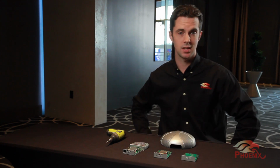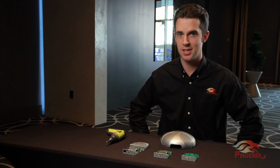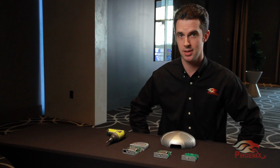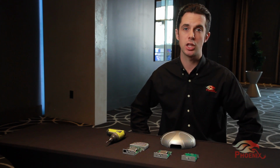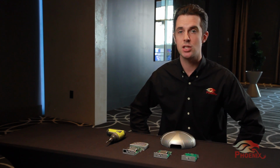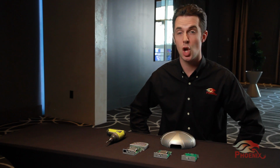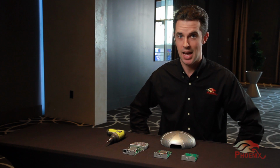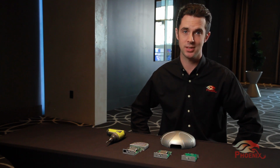Our fourth interface is the IP phone interface. Just like the PSTN interface, it comes with the built-in dial pad. It will connect to any network and behave like any other IP phone. The Quattro unit with this interface is called the MT305, and the interface card by itself is called the MT325. Since this interface supports power over Ethernet, it does not have a built-in battery.